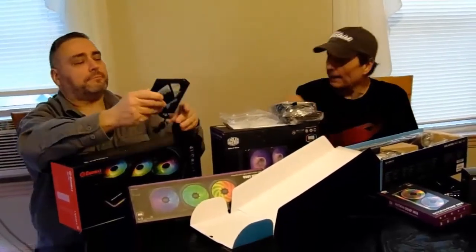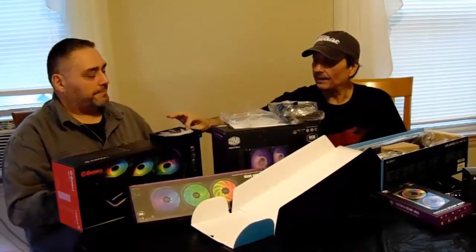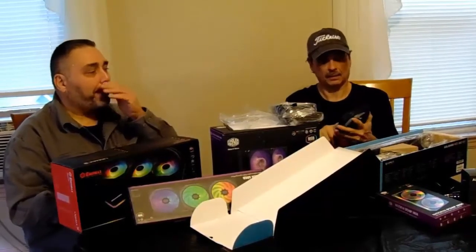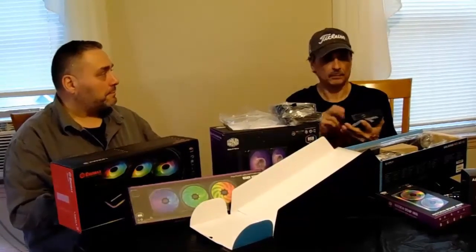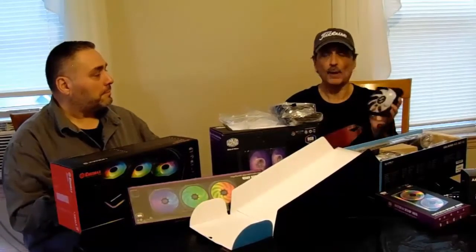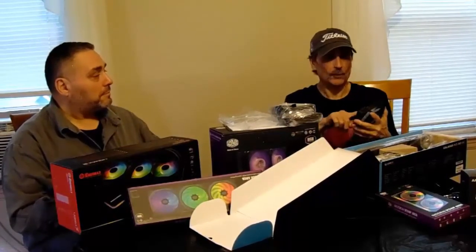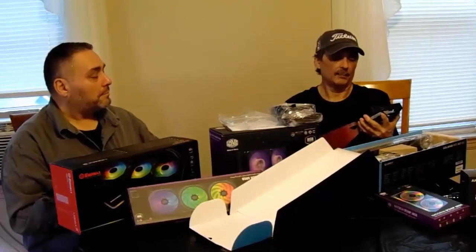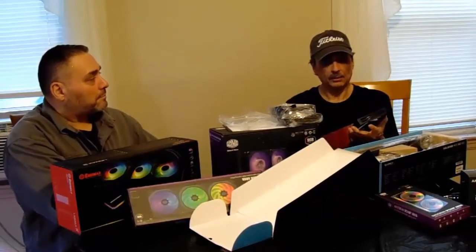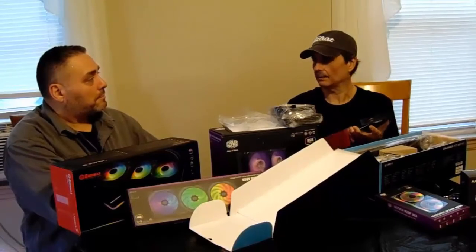And a lot of people complain about fans. They're like, oh, they're loud. A decent fan is only going to get as loud as you make it. And most of the noise comes from, well, if it's spinning at 2,500, 3,000 RPM, I don't care what you have, it's going to be loud. So if you're going down at like 800, 900 RPM and you're just pulling air through your cooler, it's going to give you what you need, unless you've got to be overclocking.